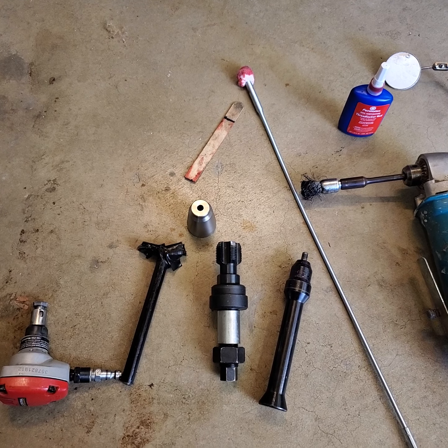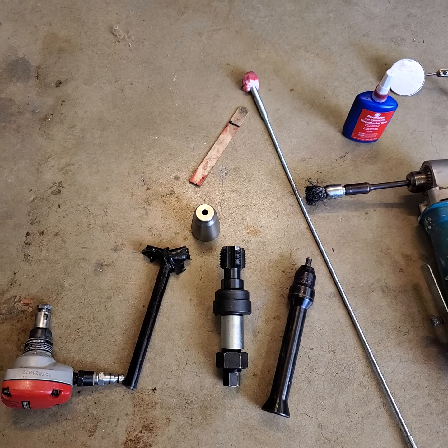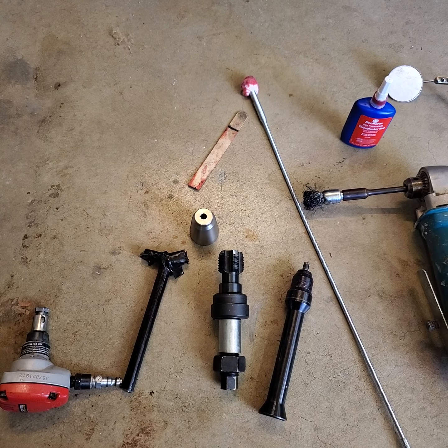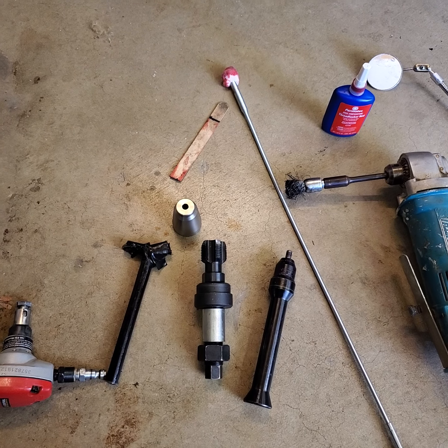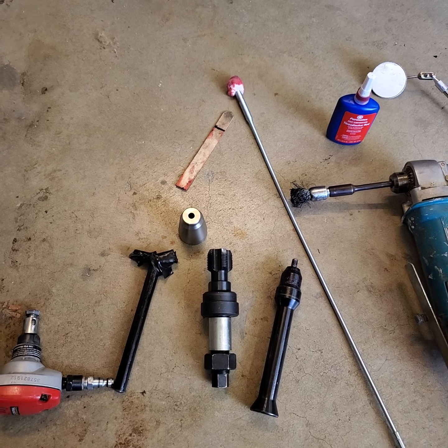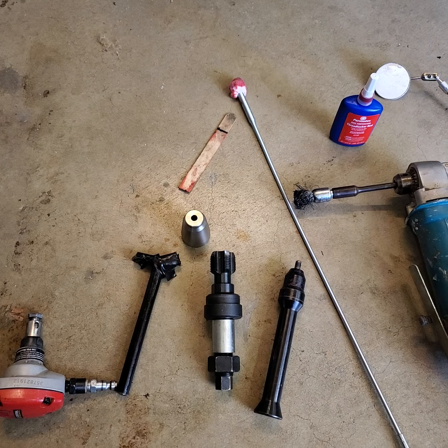I spent easily a year chasing around coolant leaks in my engine. They were using silicone on the quick disconnects on the back of the engine. You know how the coolant is routed around the back of the engine and there's quick disconnects in there? Well, they melted away and they leaked. So on and on I was finding leaks, and it was all because those brass injector cups leaked. Anyway, I've had mine out two or three times, and this time I found that Riff Raff had these stainless steel ones.